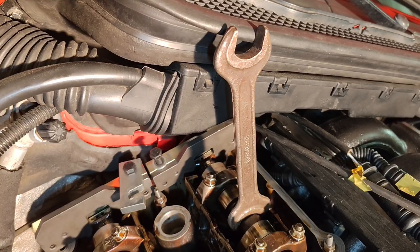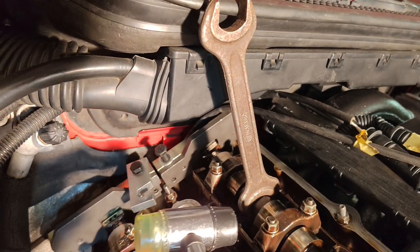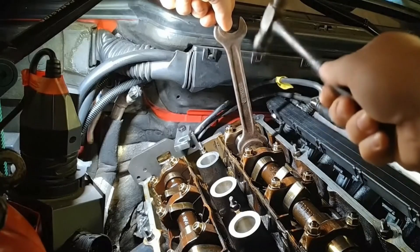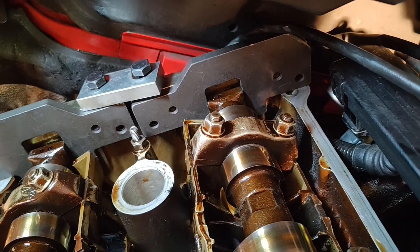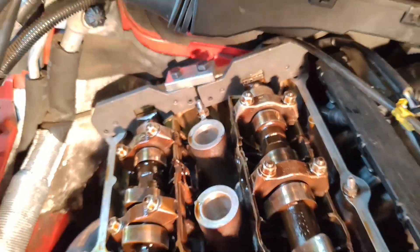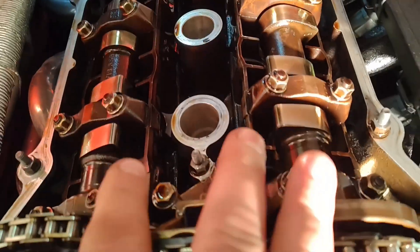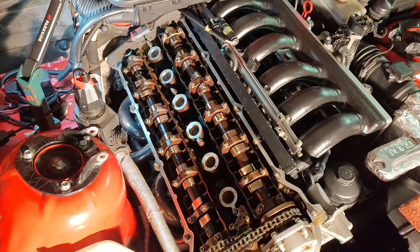For this procedure, which needs to be very precise, I'm using the trusty old ancient open-end wrench and just a hammer. I tapped it a couple of love taps to the right, and now it's flush with the block and head. This is parallel — those two back cam blocks. So this is back to stock timing. You can see the lobe now moves a little bit to the right and they're really facing each other. Job is done — just need to tighten this again and bolt everything back up.